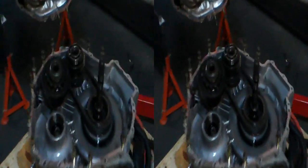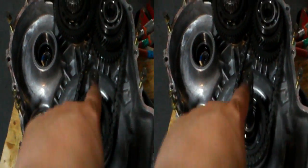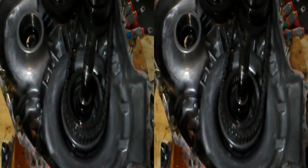There's a Prius engine down here — a bit dark, I know. That there is what would be the clutch plate — I think it's just a flywheel, a sprung flywheel basically. So that bit fits onto there, which as far as I can tell goes through and becomes the sun gear of the planetary, of the epicyclic gearbox.